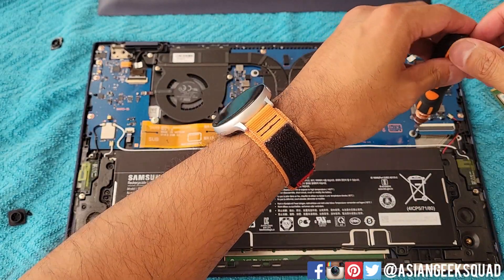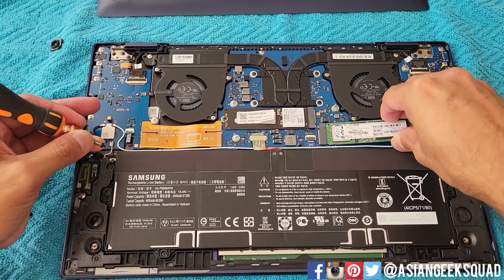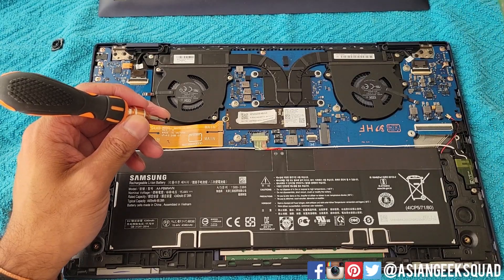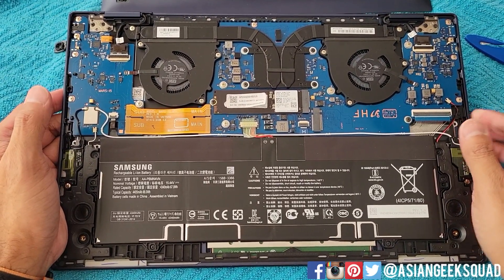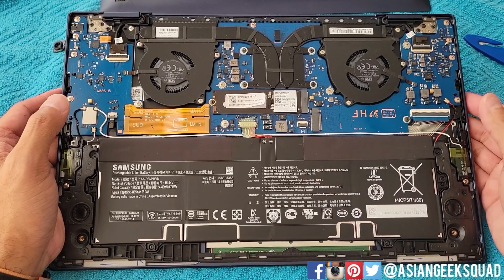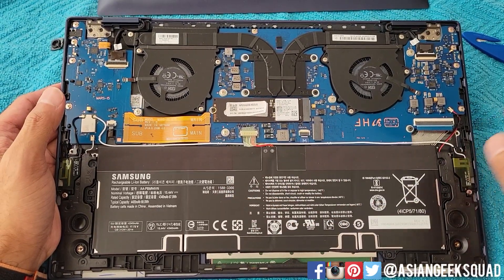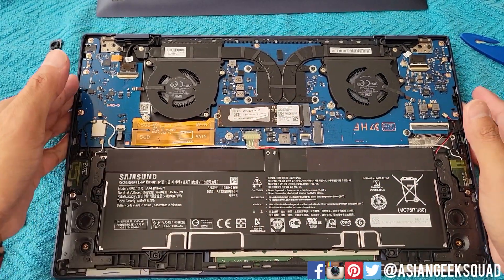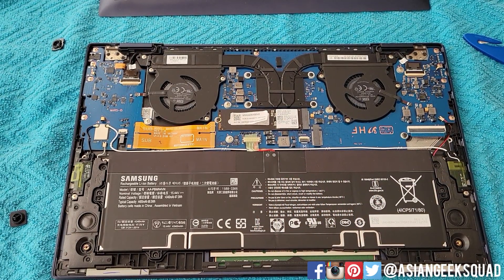We're going to go ahead and remove this screw, then line up the notch and push it all the way in, and then you would screw it in. I'm actually not going to do that right now because I'm waiting for a 1TB M.2 to come in. So for our upgrade process, that's all we are upgrading today. You have the capacity to upgrade your current SSD and add in a second SSD. Now in terms of RAM, it doesn't use traditional RAM sticks from what I can see — it probably uses the smaller RAM version, and that's as far as I'm comfortable going without taking this apart more. At least on the 15-inch model we know there are two SSD slots, and sorry I can't help you with upgrading the RAM.